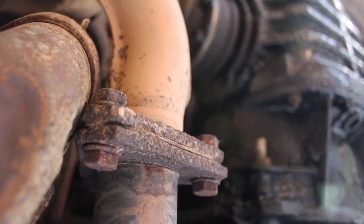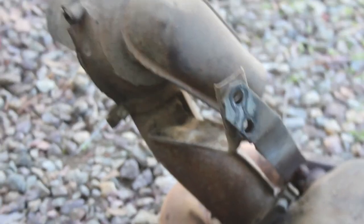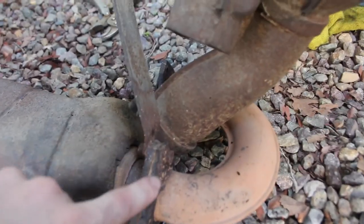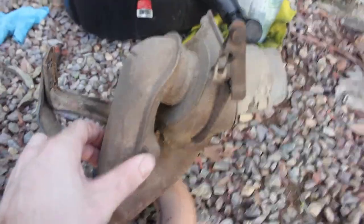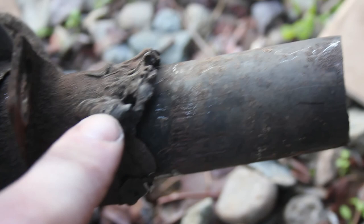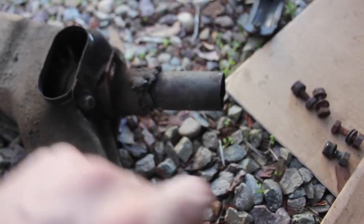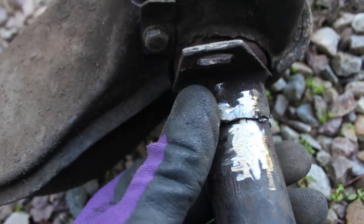If we go over here, we've got these bolts that look way easier to get out. After a little bit of time and wrestling, we got the right side heat exchange box off. Taking a look at this thing - this is where I attempted to undo it, super rusted again. Trying to bandaid it. We have this heating mechanism part here - I'm not really sure if it works, it wasn't really hooked up. We got a gasket, really old, worn out, rusty. Took this off because this is where we're going to have to weld. Someone did a little patch job here. The whole purpose of taking it out was easy access to grind. After some grinding, we got a somewhat decent surface to work with here for welding.